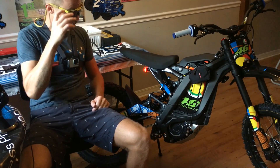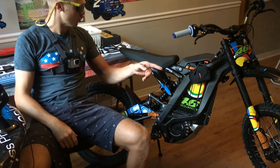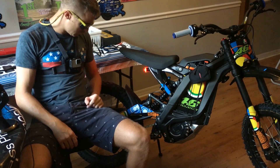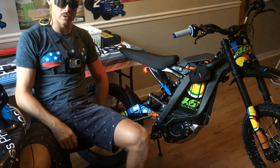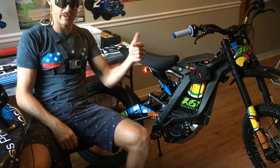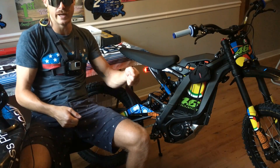And you're going to get more top speed. It feels really good. I'm going to be putting another one on the front. The tire change was not a big deal — just keep an eye on it: when you loosen up the 17 millimeter lock nut, remember there's actually an allen key on the other side. I was cranking on that thing and you have to hold that allen key at the same time.